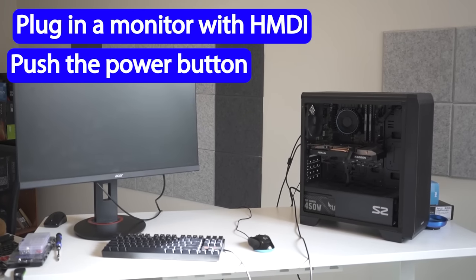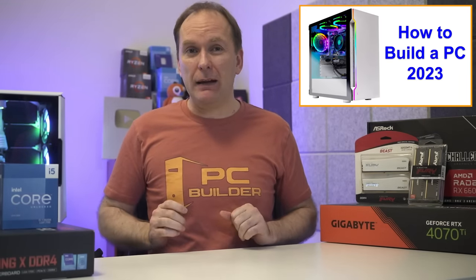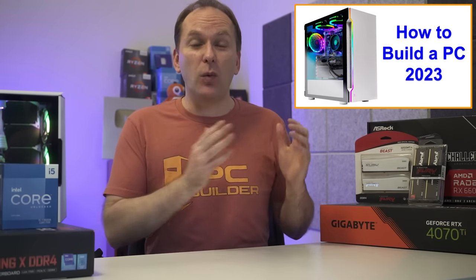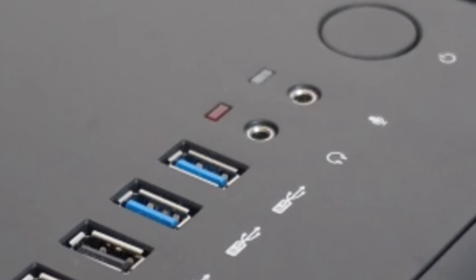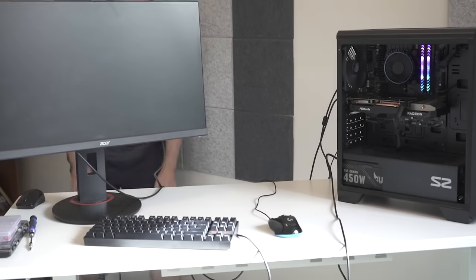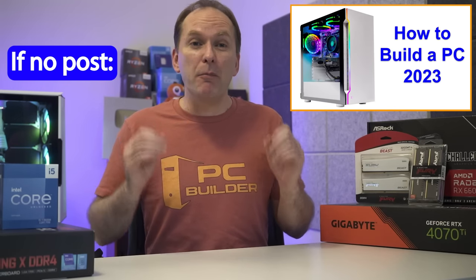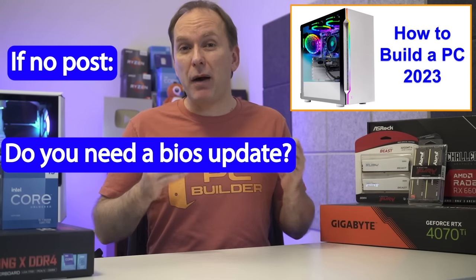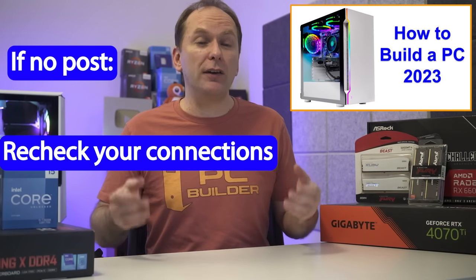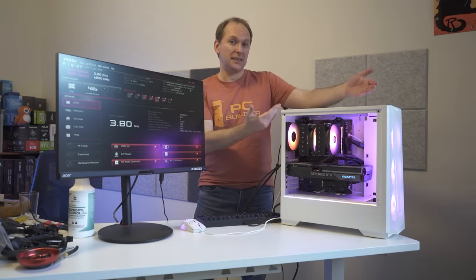Let's see if we post. Connect a monitor using HDMI — DisplayPort can be a little weird on first post, so I always recommend HDMI. Make sure if you're using a GPU that the cable is plugged into the GPU, not the motherboard. Plug in the power supply to the wall, turn the PSU button on, and press the case power button. If you have debug lights or a post-code readout, pay close attention in case of an issue. Give it a minute — sometimes the board will need to power cycle a couple of times. If you don't get a post, make sure the board doesn't need a BIOS update. For boards with a BIOS flashback feature, you can go ahead and flash it. If that doesn't work, check all your connections again. When you get that post, you can proceed to setup or power it down and finish the build.